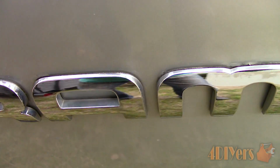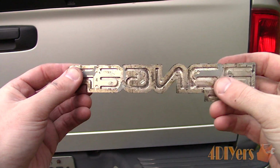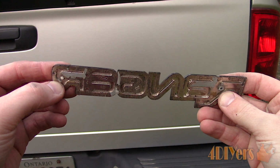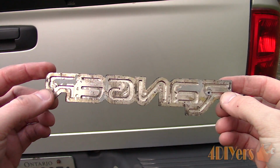An example of this would be on Ford Rangers with the fender badging. The pins in the rear have been broken off, but you can see their locations. Typically, the larger solid badges do have alignment pins, but this can vary between vehicles. It's best to do an online search, ask around on car communities, search replacement panels for the holes, search replacement emblems, or try to view the backside of the panel if possible.